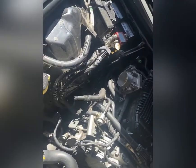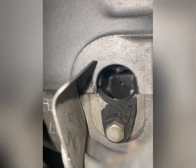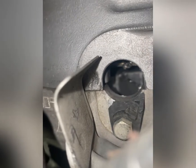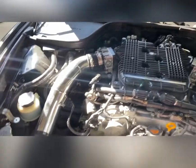I'm gonna show y'all what I meant by the bolts going loose and damaging everything. Look — this is the bracket for the position sensor. You can see the scratches inside. This is the flywheel on the left and the engine side on the right. Good thing the engine barely got hurt, but the flywheel looked like Wolverine acted on it.